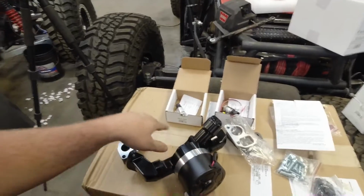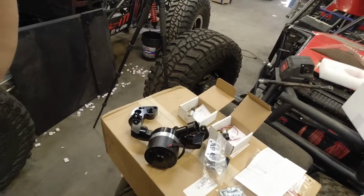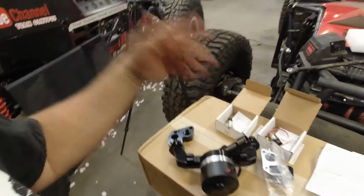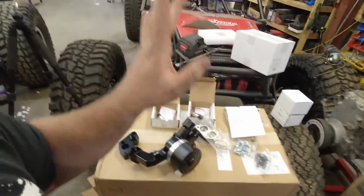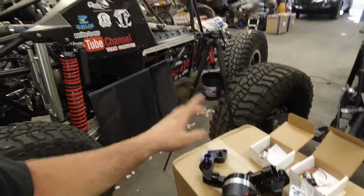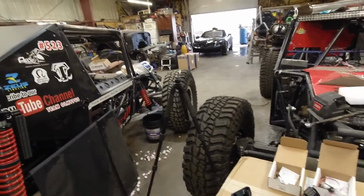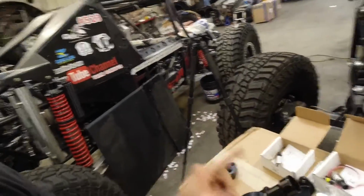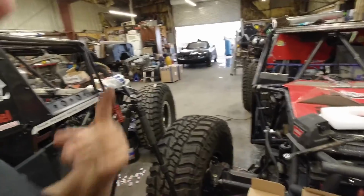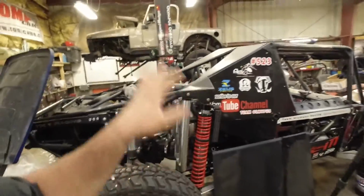Guess not. But the other thing that's really cool, trophy trucks have been running these, and they've been working great for the go-fast stuff. But one thing that's really cool is because these are constantly flowing, when we get in the rocks and everything slows down, your engine RPMs are lower, you're still going to be flowing a lot of fluid. So it's constantly cycling at the same rate, always cycling fluid over and over. So it should help with cooling even better than what we have now.